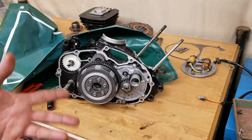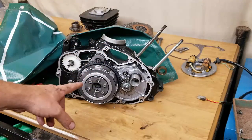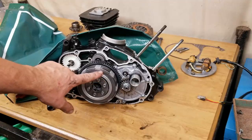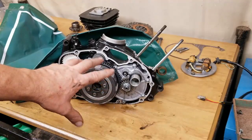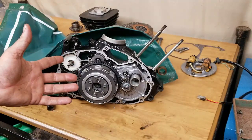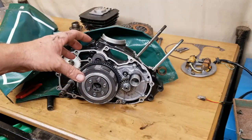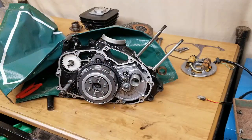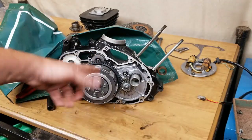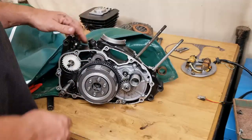It was one of those things where I found better parts and pieces, like the steel clutch housing basket, the aluminum, which these are all aluminum, but some of them, the whole piece is aluminum, and now it's got another steel there, so I have more steel to grab, which is the best material as opposed to aluminum. Unfortunately, this housing on the back side is the only aluminum, so for the weak link in the clutch, it's going to be the back side of that, which is not really all that bad, because now I got 4 steels as opposed to 3 steels and 2 aluminums. Now it's got 1 aluminum and the rest is steels.